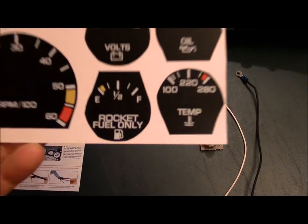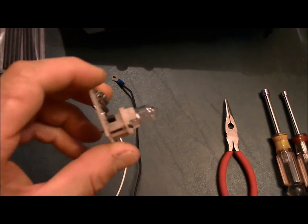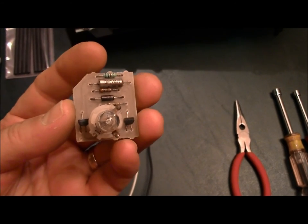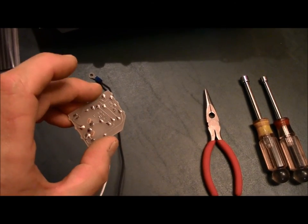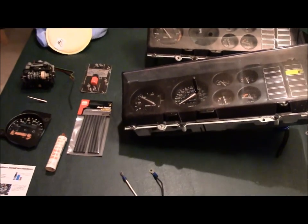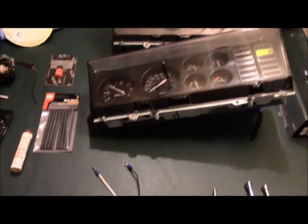Here is the little circuit board. I got this from G Body Parts — there are a couple of places you can pick this up. Basically what this does: it goes in the back of your rally gauge. You take a pair of wires, there are two connectors on the back that I've got to solder the wiring to, then send it to the fuel sending unit and also to the ground. That is going to allow me to have a low fuel light, which is a mod that is done on this car. People do it — it's kind of cool and I want that.